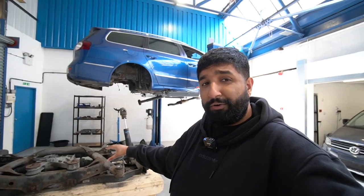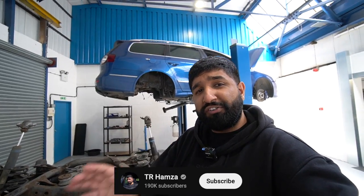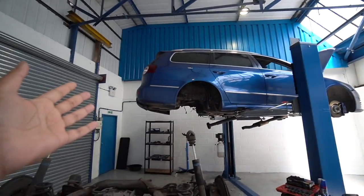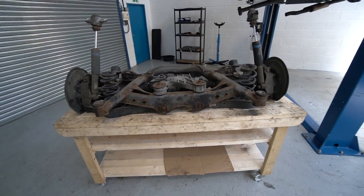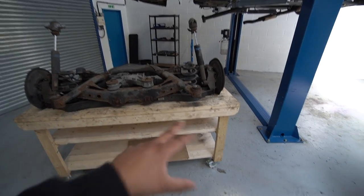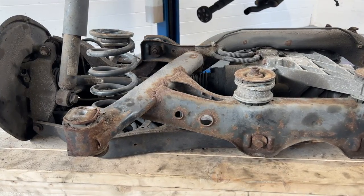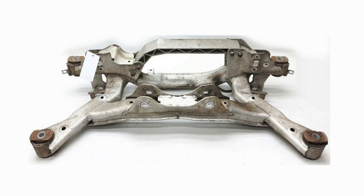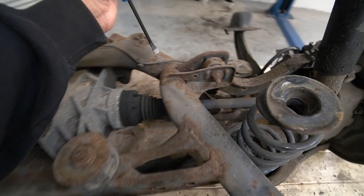It's the next day. We're going to have a good look at all of this assembly on the table and the underside of the Passat. Make sure you're subscribed if you're enjoying the video — we never used to drop subframes before, but now that we've got the unit we can level things up. The rear end of the R36 fits perfectly onto this workbench — that's six feet in length. The first thing you notice is quite a bit of surface rust on the subframe itself. It's strange they didn't use an aluminium subframe for the R36, because certain cars did — I think the A3 3.2s and some early Mk5 R32s had one.